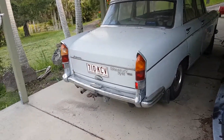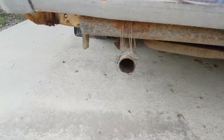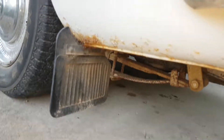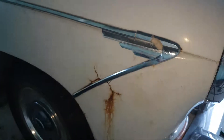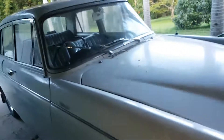It's got one broken tail light, but we've got a replacement for that. I've got to fix the exhaust hanger, because someone's made one out of some baling twine — but that's pretty easy to fix. There's only a little bit of rot in it, actually not too bad. There's a lower section here — that's from a bad quarter dent repair. You can hear the difference and also see the paint colour difference just there, the line across there on the back quarter panel. Hence why the doors don't quite line up that well on that side. On the other front, on this side, someone's gone in with bog and just painted over it — didn't actually pop the dent out — so it's peeling back off again. But otherwise, totally original.